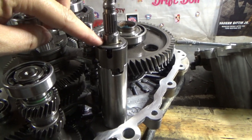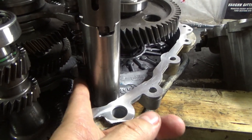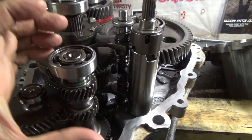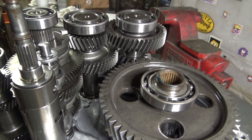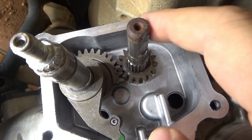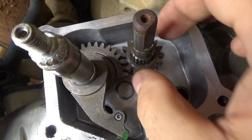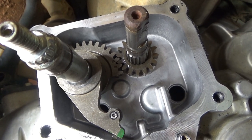The shifter mechanism is kind of a pain. They say to make sure it's in high, which gives you more room on the slot. The one thing that helped us was moving these forks — it's just spring up and down — and kind of bringing it in from the side. You just kind of got to play with it. One thing when you're putting these back together: all of these are splined one way with one big key way, so the gear only goes on one way. But also note those little tick marks on the gears — this one's got one on the piece that sticks out and it goes in between these two. Make sure you get those lined up when you're putting it all back together.